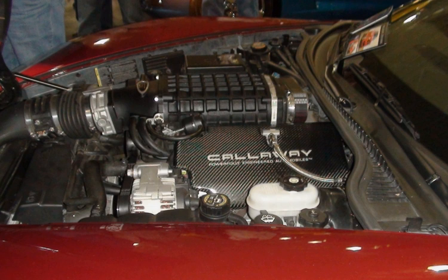Although smaller than the previous 2.3L (140.4 cu in) supercharger used on the 6th Gen ZR1, the LT4's supercharger spins 5,000 RPM faster, thus generating boost quicker while making only slightly less total boost than the LS9 engine.